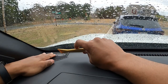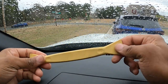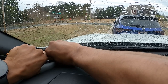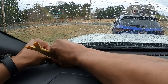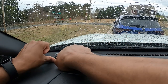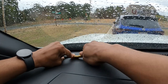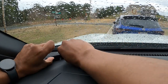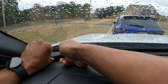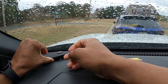Now let's get into how to actually get these out when you need to change them. First up, we'll start with the light controller sensor on the left side. Get yourself a panel tool — you can pick these up at Harbor Freight fairly cheap. Go ahead and get that in there and just start to pry it up until you hear it pop. Once you hear it pop, insert your finger in there and help the rest pop up as well.